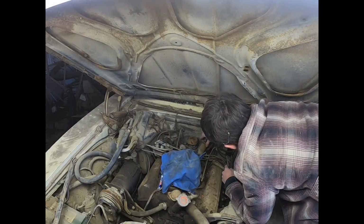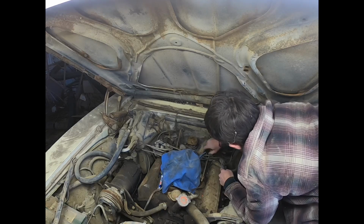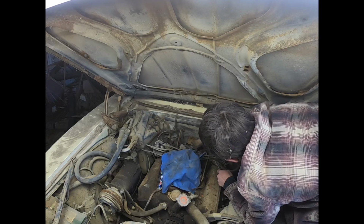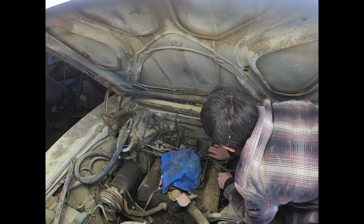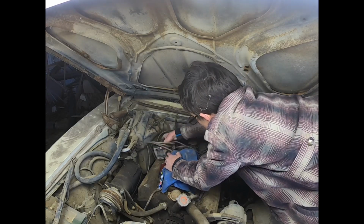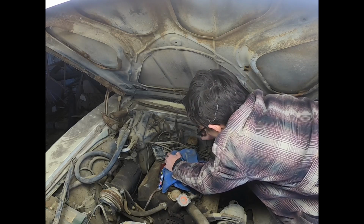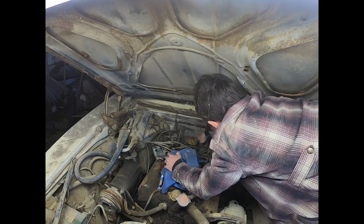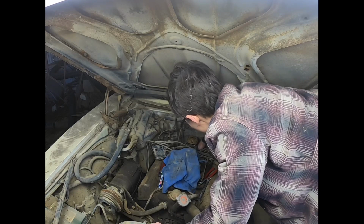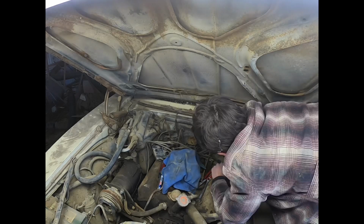Alright, then this should come right out. The screw for the tensioner to tighten the band around the coil is already missing, so I didn't have to mess with that. So that's out of the way. There's a tube over here on the other side that you all can't see that goes right around the distributor where I can't get to the hold down tab on the distributor. Looks to be a 3/8 bolt on the tube that's in my way, so I got me a 3/8 wrench.